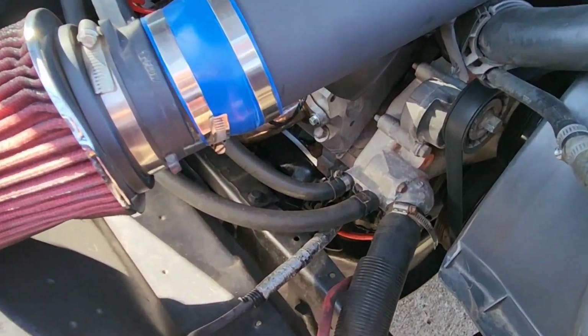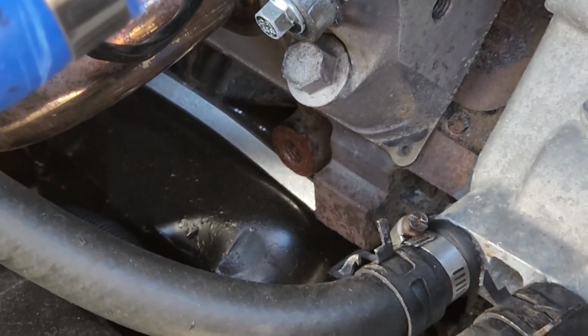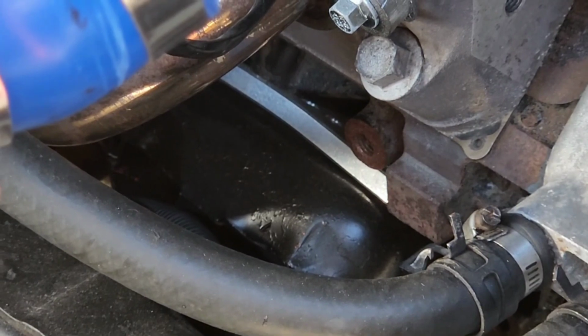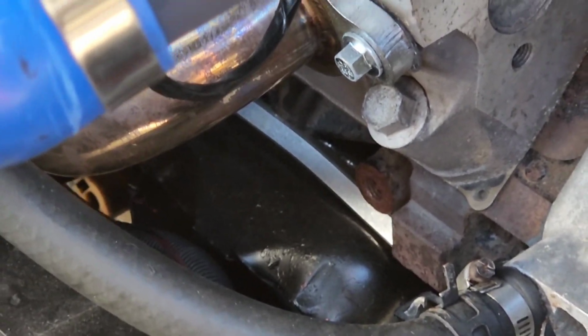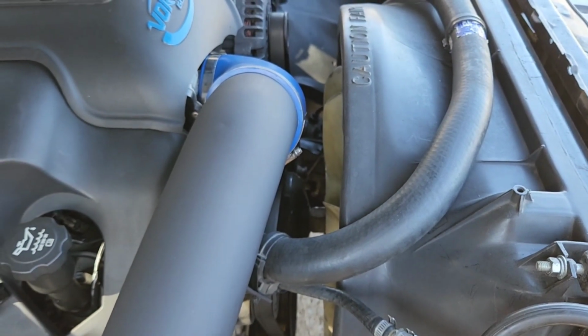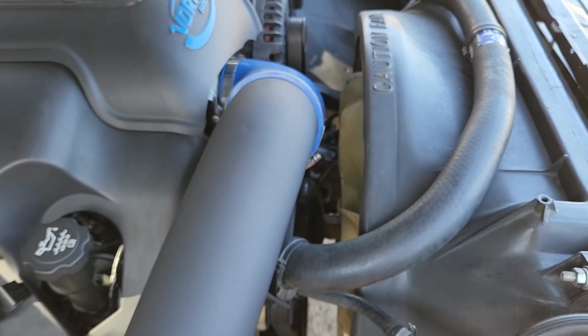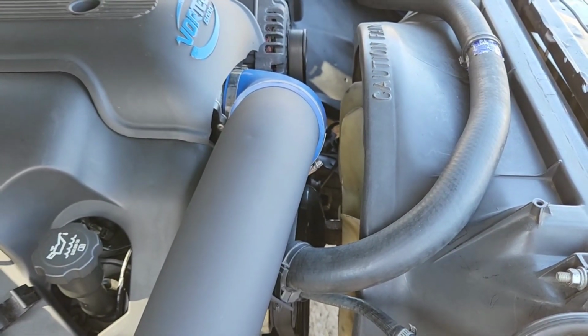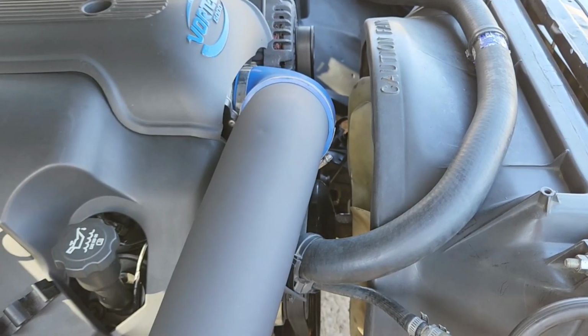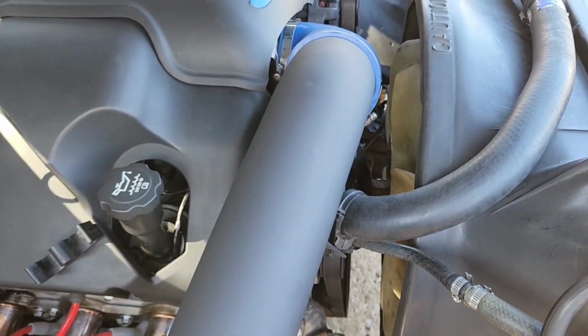As far as mounting, I used the ICT billet aluminum adapter plates. I know a lot of guys say stick them on the furthest hole, that way it sits really close to the firewall. I kicked it one forward, and that brought my fan just outside the shroud where it needed to be. For maximum cooling, that's where they say to put your shroud. I wasn't worried about the drive shaft, because you're going to have to get a custom drive shaft or get lucky like I did and go through the junkyard bin and find one.